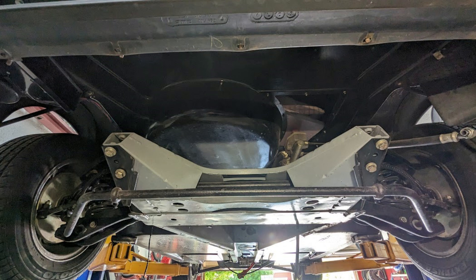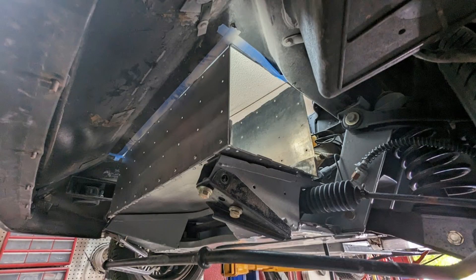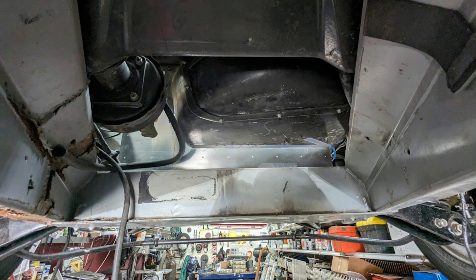That's only 12 modules accounted for, so I still need room for four more. After removing the radiator and condenser from the front, the front frame is exposed and there's a significant gap between the frame and the trunk floor. I trimmed out what was needed in the frunk fiberglass, and the front box does protrude in about two inches, but it leaves the majority of the space open — not too invasive. The nice thing up front is I don't have to build any cross members, because it sits squarely on the frame with just a couple of tie-down tabs. So all 16 modules will fit in this car, leaving plenty of room for other components like the charger, BMS, and more.